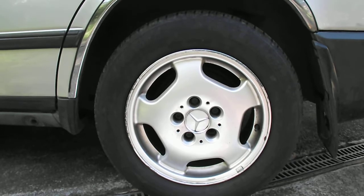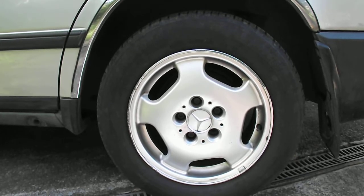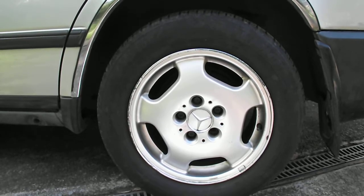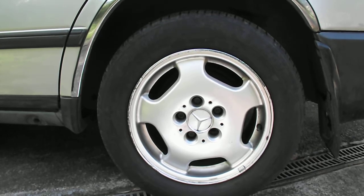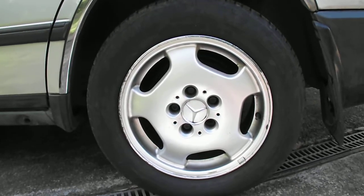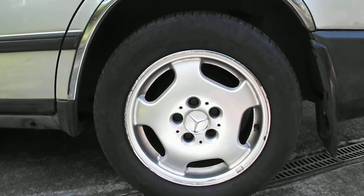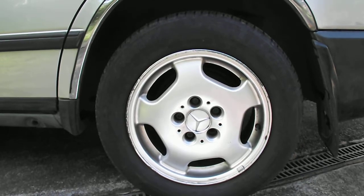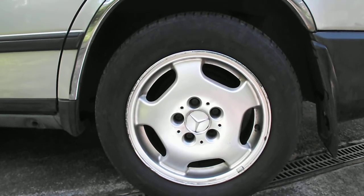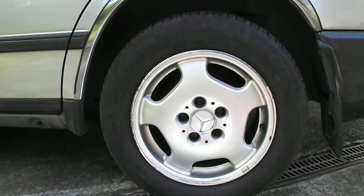People who own these will be familiar that they have the handbrake or park brake, emergency brake, whatever you want to call it, assembly inside the hub, which is also, if you're in Australia, reasonably common in, I think, some Holden Commodore models. I had a 1997 Toyota Camry that had it, so it's not all that unusual, but it is a bit odd if you're not familiar with it. Anyway, the bolts go through the hub, and if they're too long they will interfere with the brake shoes that constitute the park brake assembly, and obviously you don't want the end of a steel bolt colliding with that.